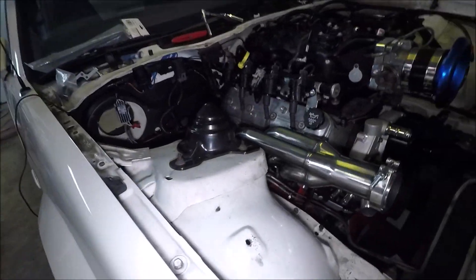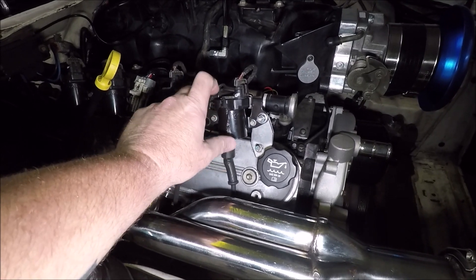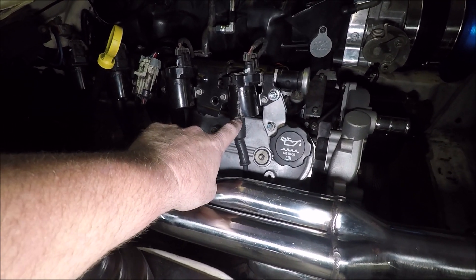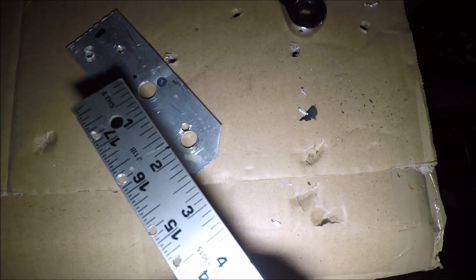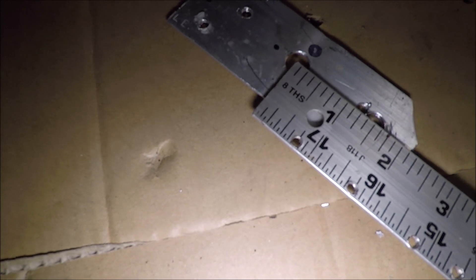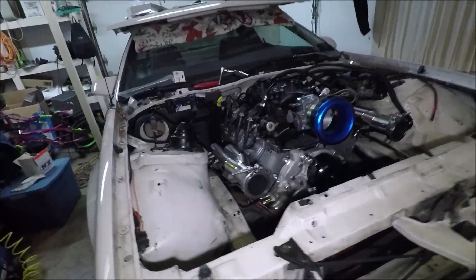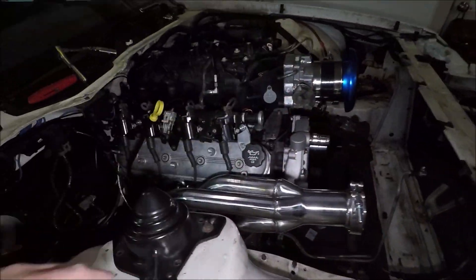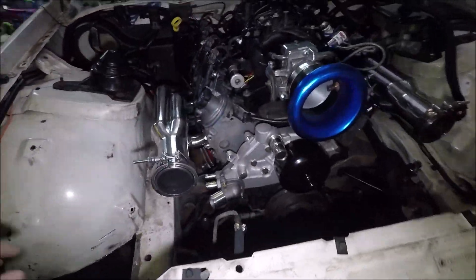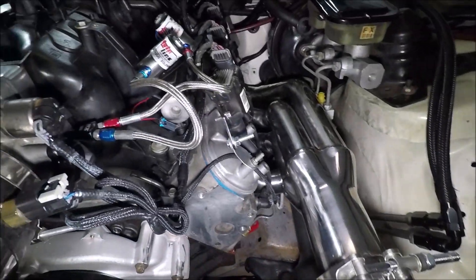It should be noted that depending on what kind of coils you're using, your spacing will be a little bit different than mine. The square truck coils have their bracket come down at a different angle — the spacing is just different. You may end up having to move it up less or a little more than I did. If you want to know the spacing between the holes in my brackets: from center of hole to center of hole is almost exactly one and a half inches. So we spaced the bracket up one and a half inches, got the coils away from the heat, got wires that fit, and it almost looks factory — if I painted those little brackets black, you wouldn't even know I'd done anything.